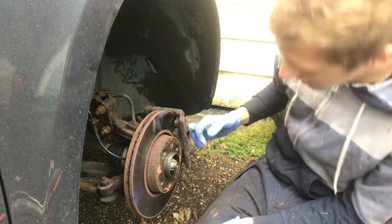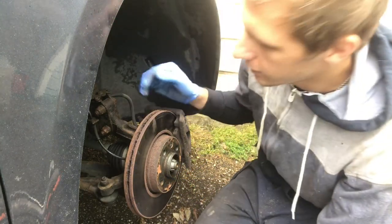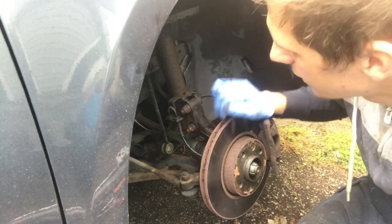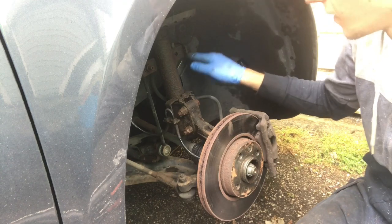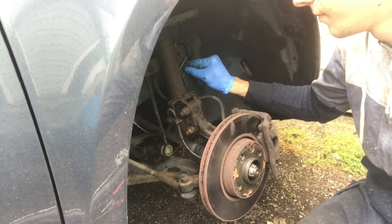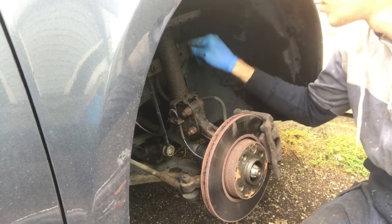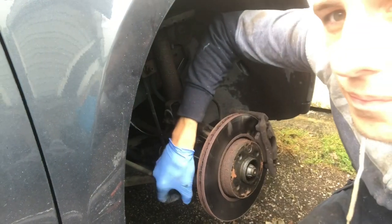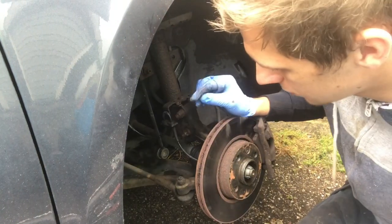Normally you'd see a bit of seepage on the back of the caliper, which I'm not seeing — which is good. Then we come to the damper. It's showing a little bit of corrosion but no signs of anything leaking out of it, so that's all okay — just a bit of surface rust. You've got your solid brake line just here. Check that union because normally on a brake line, where the union meets whatever it's joining into, that's where it'll corrode first. Brake lines are normally coated in a plasticky coating, but they couldn't coat it at the union — that's where they rust first. This one looks okay and the flexible line down there looks great.